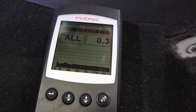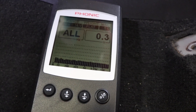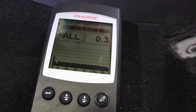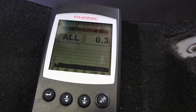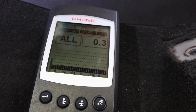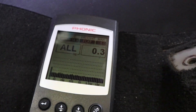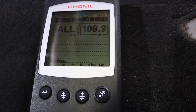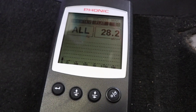This is crucial. Some older cars it did fluctuate, but what the manufacturers started doing is using data so that the radio's volume knob was actually built into the amplifier. As you turned up and down the volume on the radio, it was actually adjusting the voltage at the amplifier and not the radio's output voltage. So what we want to do is test that. We're turning the volume down, we're turning the volume up, and it's actually showing us a difference.